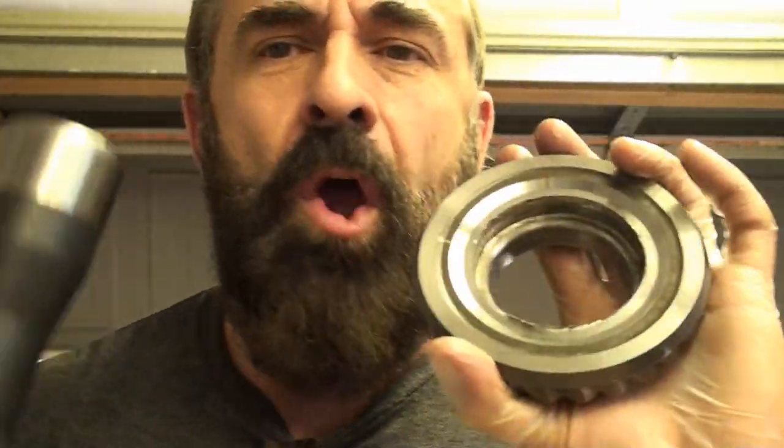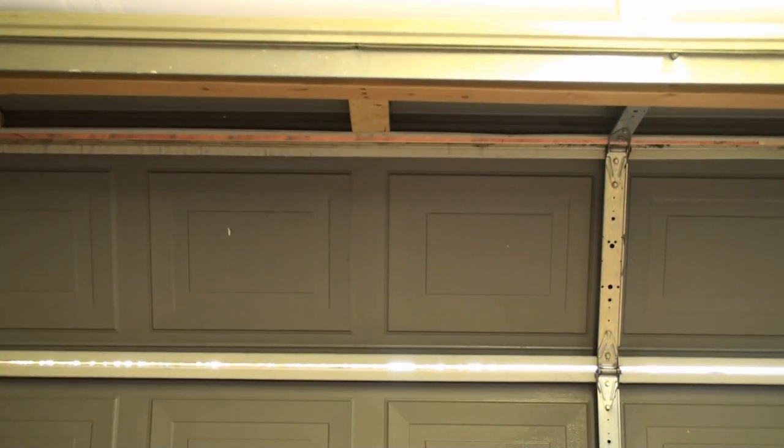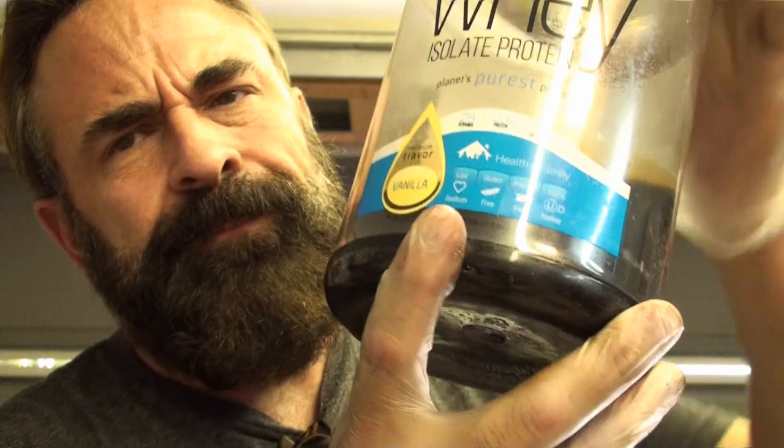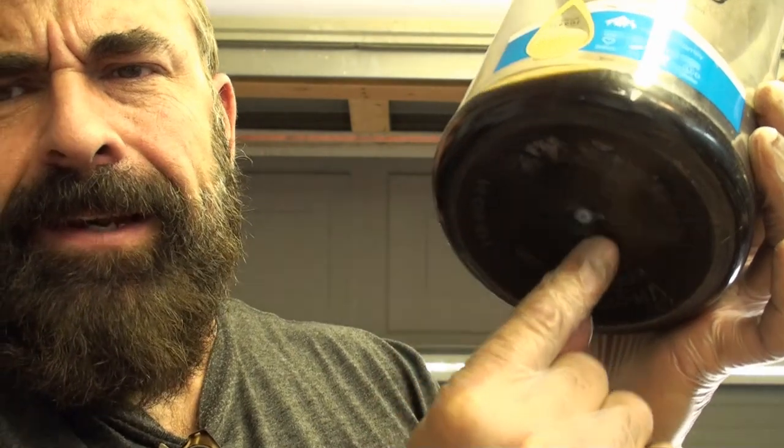But again, no noise coming from this. I put a stethoscope on there, listening to it with the wheels spinning off the ground. I didn't hear anything. I drained the oil, it was dirty, and you'll see that here in a minute. I saved the oil. The case has two magnets on the plugs, and there was just a teeny little bit of metal, nothing abnormal. Even in the oil, there are little teeny pieces of metal. But I was looking for something big. If it broke, I expected teeth to have snapped off or something, right? But that wasn't the case.